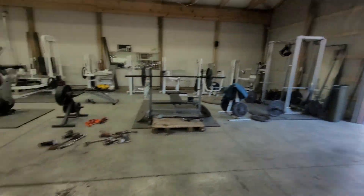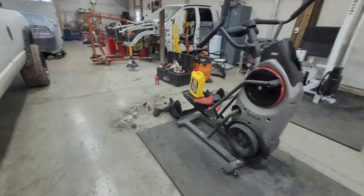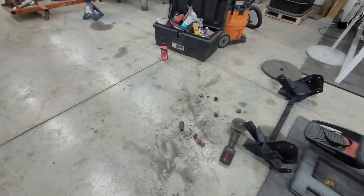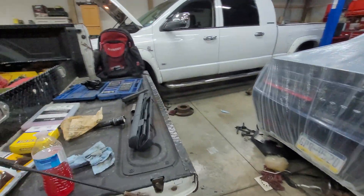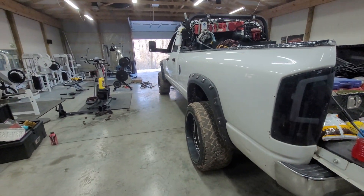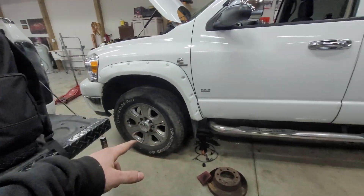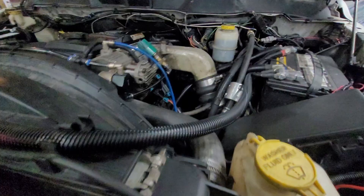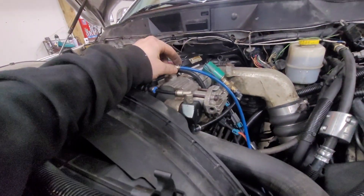We got the Mega Cab done. Here's all the U-joints and whatnot — we just got that all done. It took us about two hours. So I'm going to get this wheel back off. We're waiting on that part for tomorrow. Adjust the steering box — we're going to try to do that about a quarter turn, and then we are good. Just need to get that ABS sensor in.